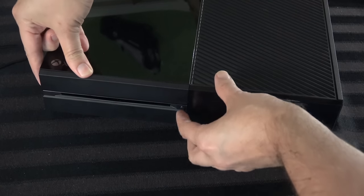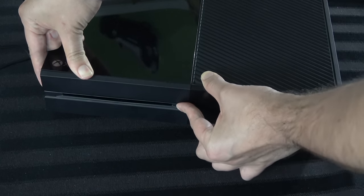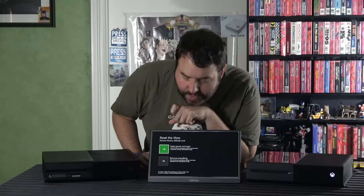I'm going to unplug it for a second and plug it back in. What we want to do is put the console into safe mode. To do that, you fire up the console, then hit the sync button on the side and the disc drive button, hold that for a moment, and it should beep again — there you go. Now we have the console in safe mode. If you hit Continue, that takes us right back to that black screen of failure. So you have options: Reset the Xbox, or do an Offline System Update.